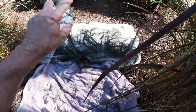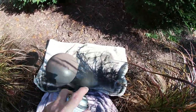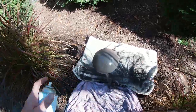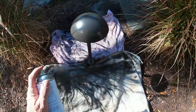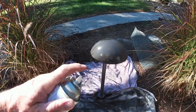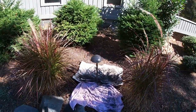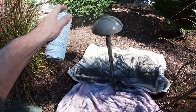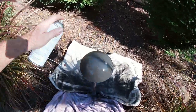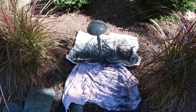When you're painting, always keep moving when you pull the trigger, and stay three to six inches away. Don't put on too much — this is called putting on the tack coat, just a thin first coat. It gets real sticky real quick, especially in the sun, almost immediately because the metal is already warm. Then come back with a second coat, go a little slower, and watch until it gets real nice and glossy.